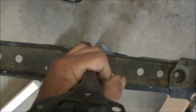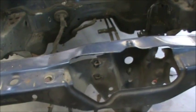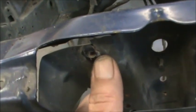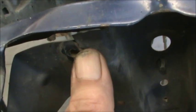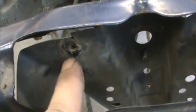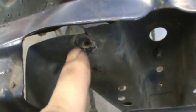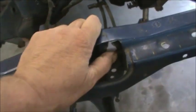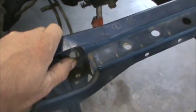See on the back side here how it needs to be pulled — and when I pull it, it twists the top around a little bit. You can see the metal has a break in it here right by my thumb. I'm gonna fix that. And over here, there's three nuts for the hood latch — one, two, and then three is here — and you see this one's pulled completely out. So we're gonna have to repair this, and I'm gonna have to do all that before I paint. That shouldn't be that big of a deal.